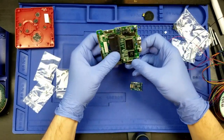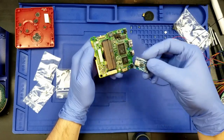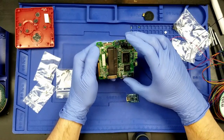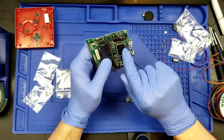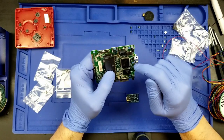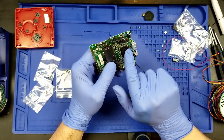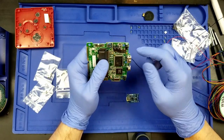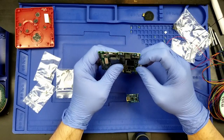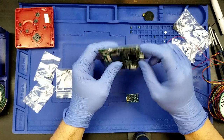So the USB-C needs to go to the charge port up here. These wires, we've got a positive up on the top and a negative on the bottom. According to the wiring diagram, we need that positive on the top to go to the second to last pin on the back of this. Yeah, the fifth pin down. It's a set of three at the top and then one in the middle and then two at the bottom. It's that next to last one that needs this wire on it. And then the negative is, well, it's a ground, frankly. I don't really understand why it necessarily needs to go to the ground on this guy, but you know what? We'll put it on here anyway.